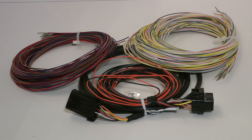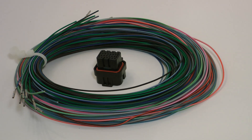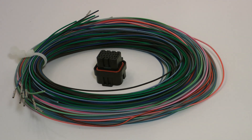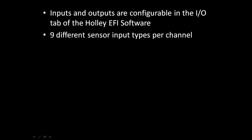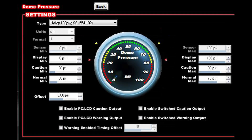The second thing I really like about the Dominator is that because it's got 23 extra inputs and 26 extra outputs, I can do a huge amount of things with those like shift lights, traction control, and different warning lights. If you're a nerdy controls guy like me, the options are absolutely endless. That's where a lot of other ECUs will really fall short of the Dominator — they'll run out of those extra inputs or outputs that you need for a safety feature that's going to save your engine.